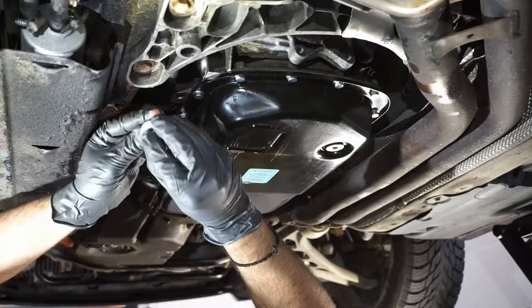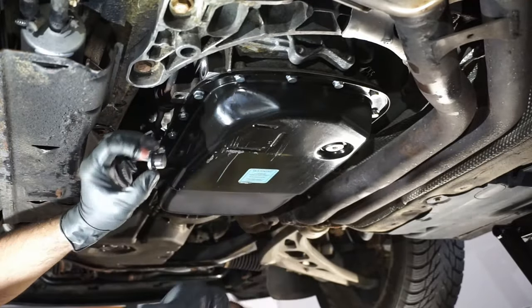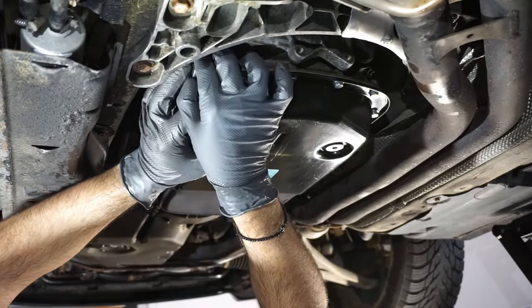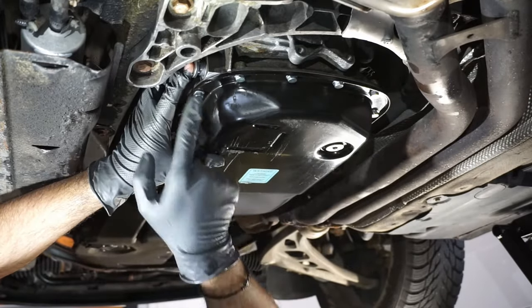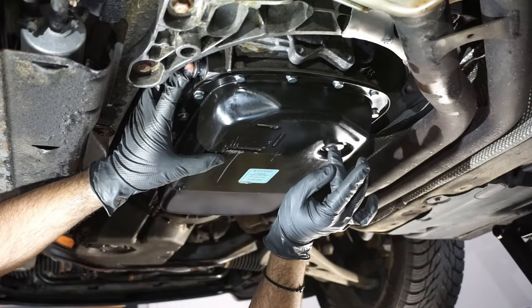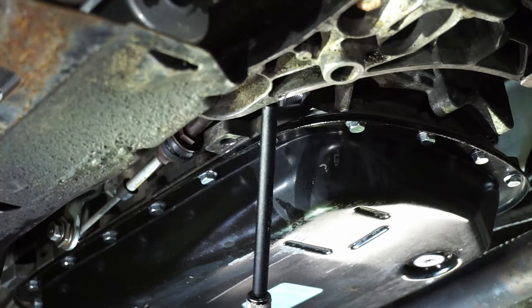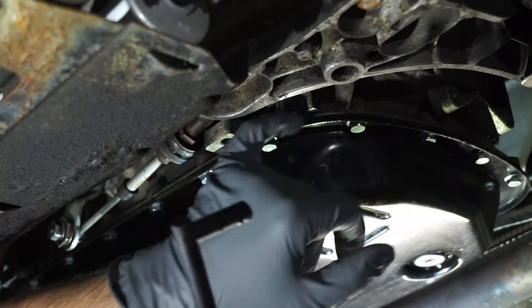Now the fill goes right here, but obviously, like I said, we're going to have to fill. But it's a T45, and you have little to no room here, so definitely try and take care here. I probably won't be able to fit my torque wrench, but I have a feeling how much this takes. This also takes 18 newton meters, but just get a feel for it. With your fill attachment, in my case, this one fits good enough.